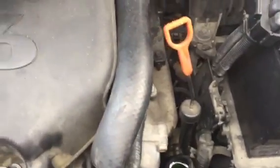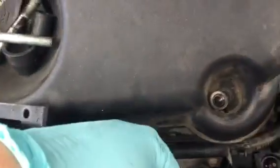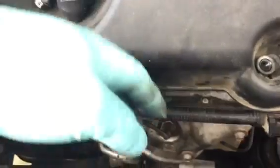So when you remove that, you're going to lift up the fans, and next you're going to do the same thing to the other fan, and you remove 2 bolts on the front, on the top, and then you pull it up the same way. But this time you have to slide over this side to lift it up. You cannot pull straight up, okay?